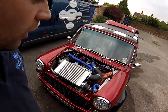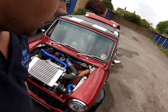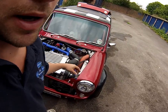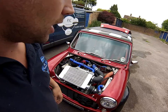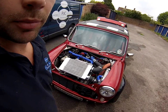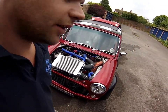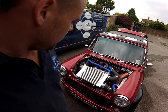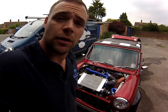In a nutshell, I run a separate cooling pump without the mechanical fan, because the fan seems to suck about five BHP from the engine at high revs. Without it, I've gained all that back — but it means you've got to run some supplementary pipes and do a bit of mucking around to get it to work. Any questions on that, let me know. Be safe.